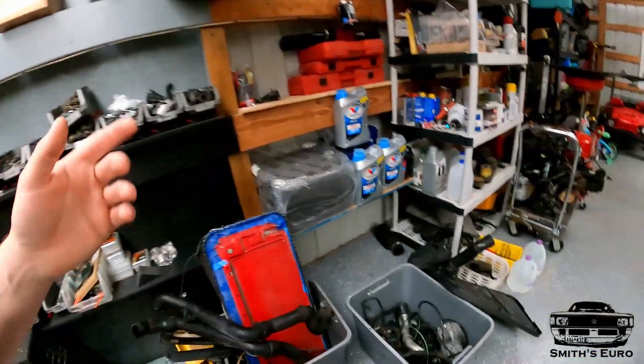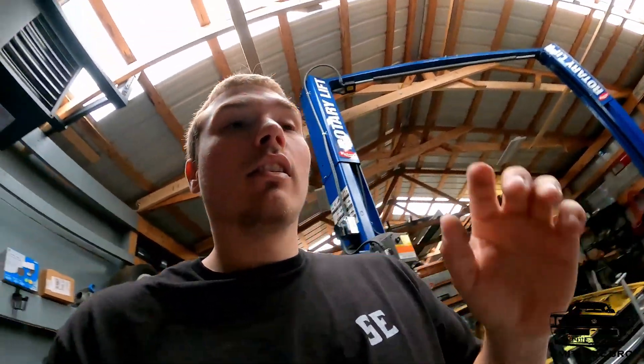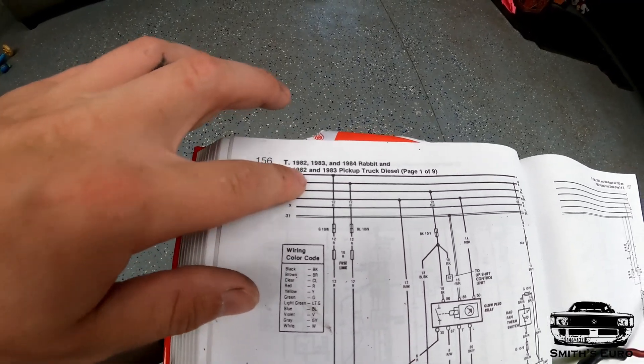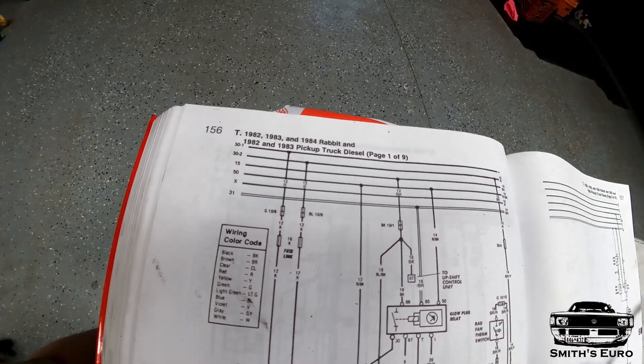The next plans are to start working on the wiring harness from the Mark 3. There aren't many wires we actually need, so I'll get out the Mark 3 Bentley manual and follow along through the ECU pages to find switched 12 volts and solid 12 volts on the fuse box wiring. Terminal 30-1 and 30-2 are constant power directly from the battery; 15 is switched ignition; 31 is ground; and X is what turns off when you turn the key on. That's what we need to dive into next to figure out which wiring we need for the Mark 3 engine.